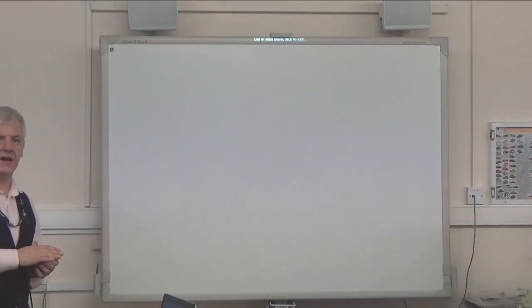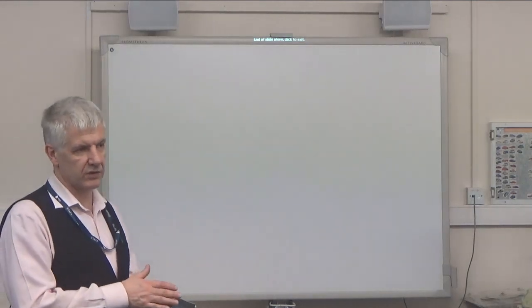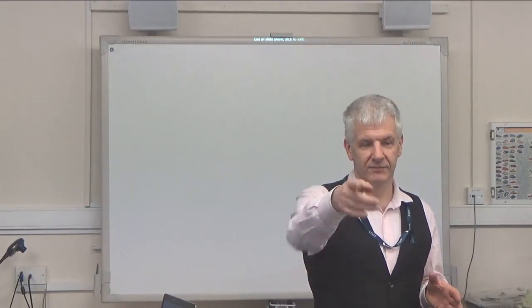In terms of a front wheel drive gearbox and a rear wheel drive gearbox, could you tell me what the differences are? A differential inside the front wheel drive. Okay, so the real proper description of that is that the front wheel drive gearbox has got both the transmission and the axle in one housing. The shortened name for that is transaxle. Say again? Transaxle. It's a transaxle. Transmission. Transaxle.